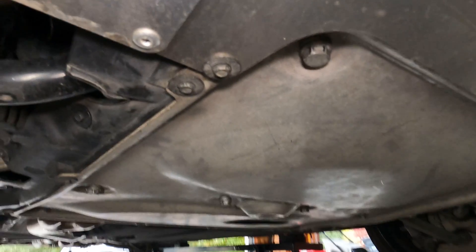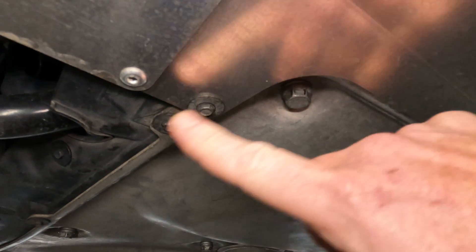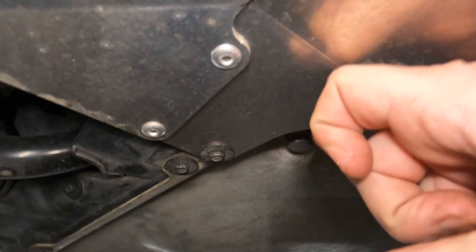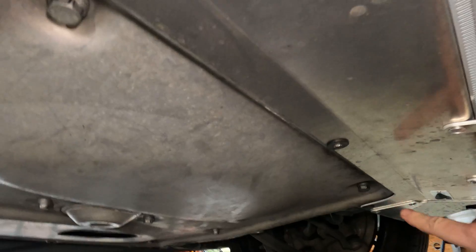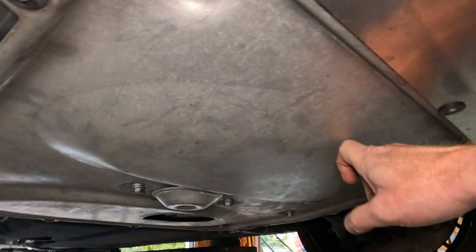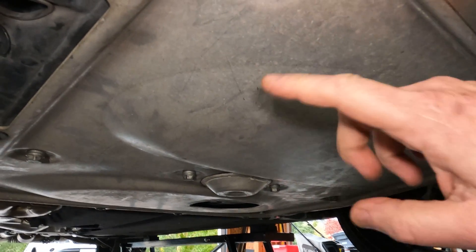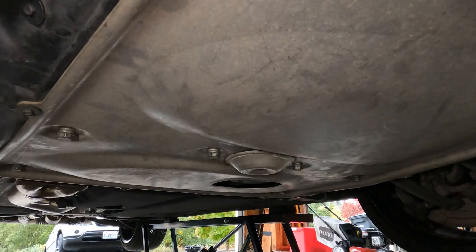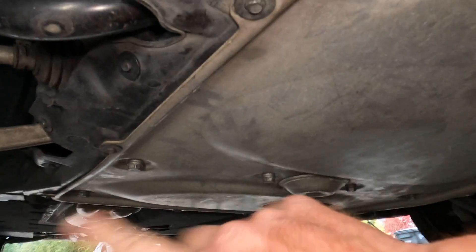The very first thing we're going to do is take out that whole series of bolts that holds on the stiffening plate underneath. Here we are underneath the car. If you're not familiar with taking your stiffening plate off, you've got a whole series of 8-millimeter bolts — these little plastic trim bolts that go all the way around. I've got the Turner Motorsport skid plate, so this piece is aluminum, but if you haven't replaced yours, it's going to be black plastic with the same 8-millimeter bolts around the perimeter. Take out all of the 8-millimeters around the perimeter, and then you've got all of the 16s on the stiffening plate. When it drops down, it's pretty heavy, so take out the perimeter ones first and leave the center ones to the last so it's not sagging. As you take out the last bolt, brace it and set it down.